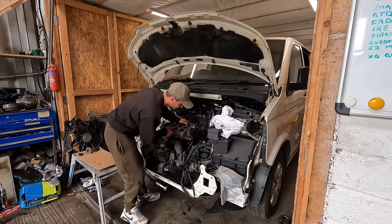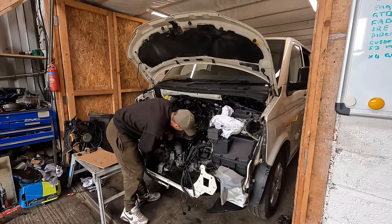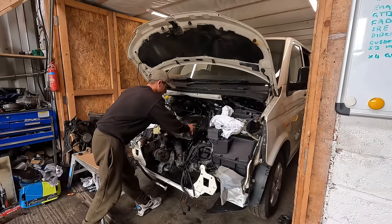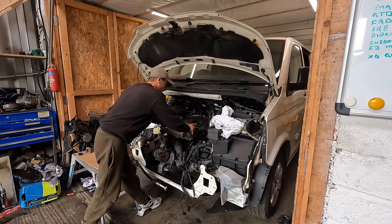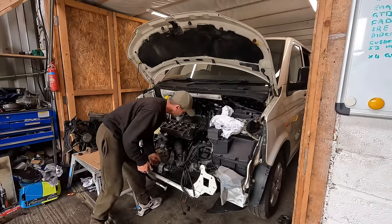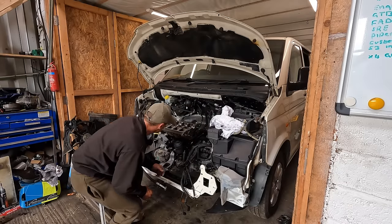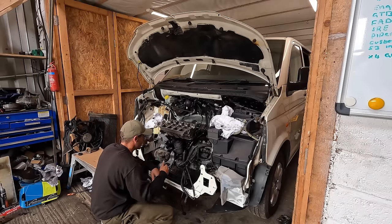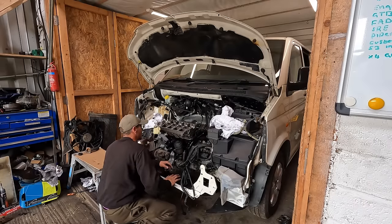Well, that's the fadonk. And now, if I try to move the head, because the dowels, the locators are in place, I can't. The head won't rock, so there's nothing trapped underneath. You can visually inspect. And then if we look round here, I can see that that is sat flush.